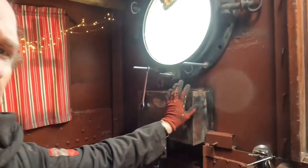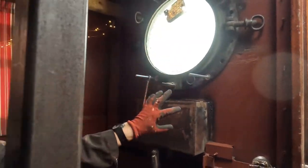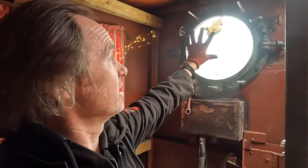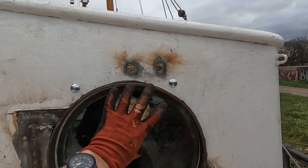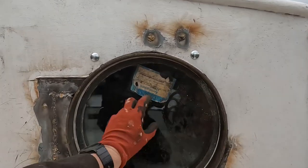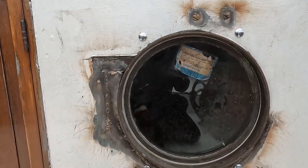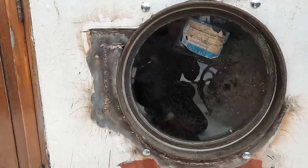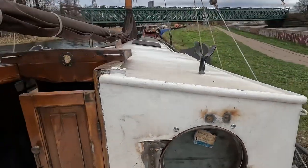Okay, this is another day. Today we're going to clean up this mess here. I need to weld the inside of the box and weld what I did here, and tidy up this area. I also discovered that when I place these bolts in, the window is actually slightly off - that bolt is higher than that and the window needs to turn that way. So I need to take this out, weld up those holes, get all of this tidied up and ground down, make it nice and neat, then pop in all the bolts and get it sealed with Sikaflex.